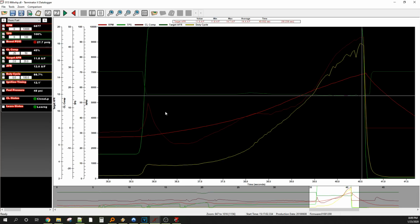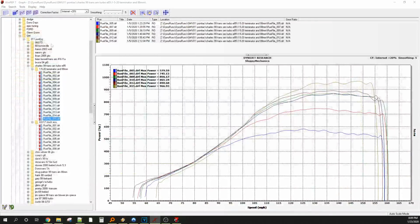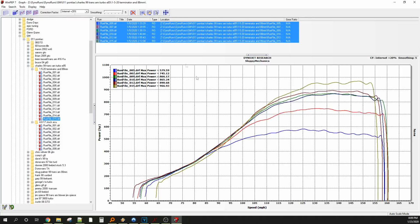So it seems like this thing wanted to keep going. We just did not have stable fuel and of course laughed about it. And, you know, he left with 9 and change. So this thing on like 20 pounds had fairly rock solid fuel pressure, and it was capable of like 8 and change to the tire right there. So all he's got to do is get some fuel. And this turbo and combo seems like it wanted more boost.